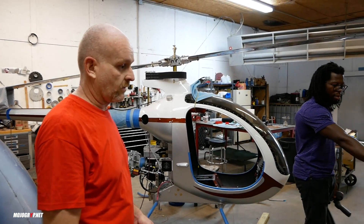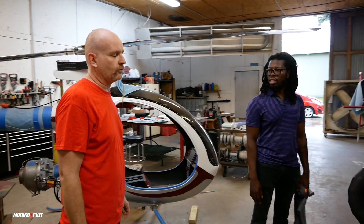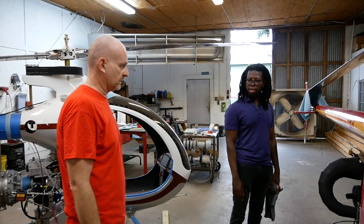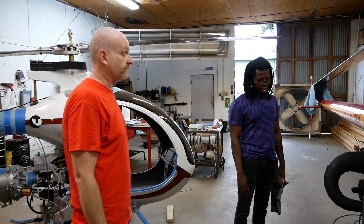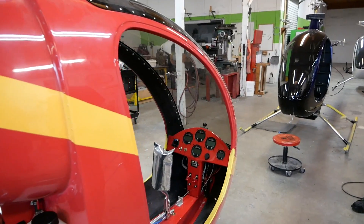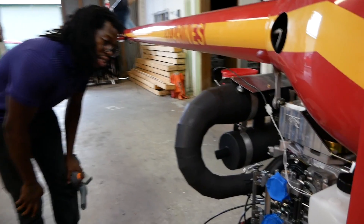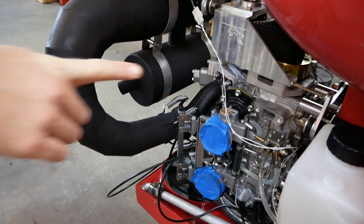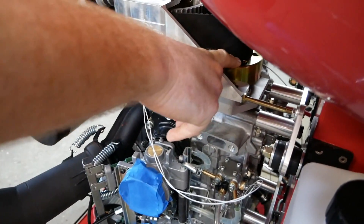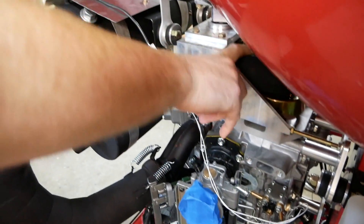What's the powerplant? That is an 800cc, two-cylinder, two-stroke, water-cooled, fuel-injected, oil-injected engine. It's good for 140 horsepower but we detune it to a maximum of 85 horsepower. That 85 horsepower feeds into a centrifugal clutch, which opens up and grabs at roughly 2,200 RPM, going into the first gear reduction at 6,000 RPM at 100%.